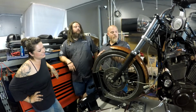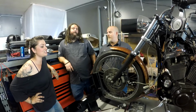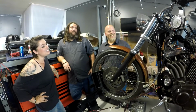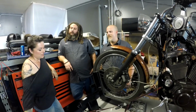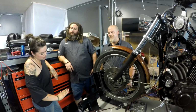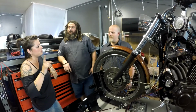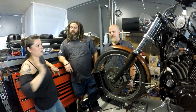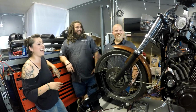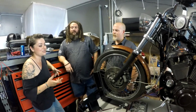The other fun thing we got to do with getting those to be painted was to totally disassemble them and fully rebuild the forks. There's a lot of air in there that you got to purge. So there's a lot of very carefully unscrewing it so you can take the spring out, but also making sure that you maintain pressure so you don't lose an eye or kill your partner, which I think I almost shot you with a spring at one point in time. There was a very quick brush back. It was a very ninja quick push away. But yeah, nobody got hurt, which was good.